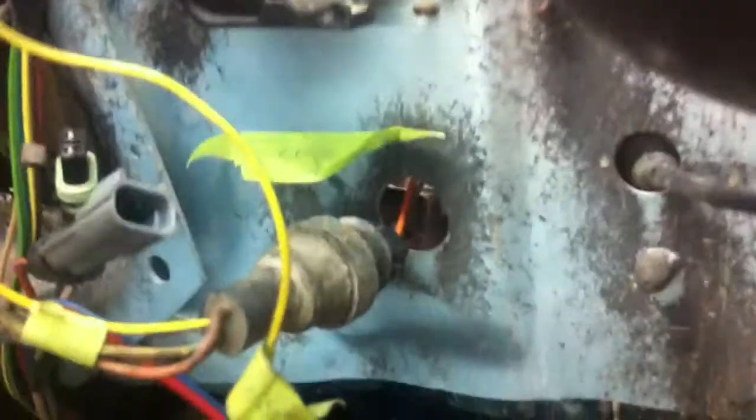I will have to change the tail light connector here as well. That would have plugged into the junction box at the front on the 90 harness, so I'll have to change it. I've got the pigtail cut off in here somewhere — there it is. It's the same colors, so I just have to wire it up and it'll go back on. I'll have to mess with the headlight connection too, because I want to run the quad light front end. So that'll have to be rewired from the 86 to the 90.